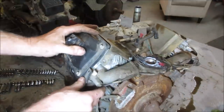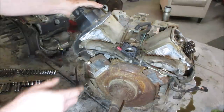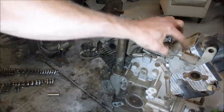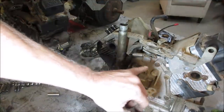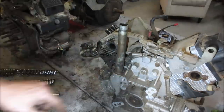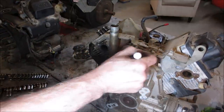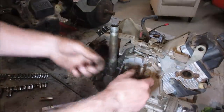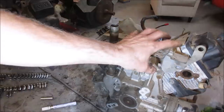And what are you going to do next? The intake manifold? What if we get these out of our way. I think we have to get rid of this whole throttle assembly anyway. Let's concentrate on that, what's holding that in place. So we want to get rid of all of this. See one there, one there. And I'm going to take a little white paint stick, and we're just going to mark where the throttle linkages were. Mostly just that one is the important one. That part, the governor, is going to stay attached to the engine. This can go with us. Let's get these two bolts off and see if this assembly will come out.